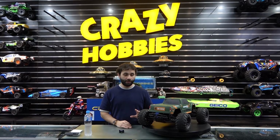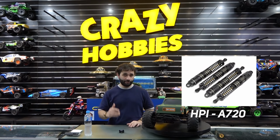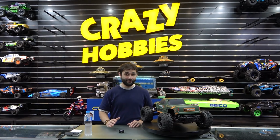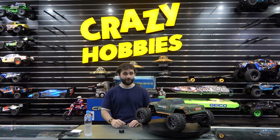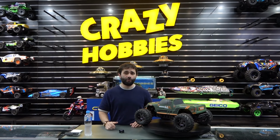Like me and Angus were talking about the shocks. HPI part number A720, and they retail for about $180 Australian. It's a pack of 4, they're all aluminium, and they do come with titanium shock shafts. Titanium does not bend, so you will not get what you've seen on the car. So titanium, aluminium shocks, $180 for 4.